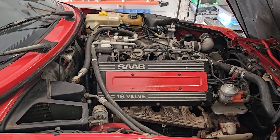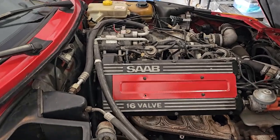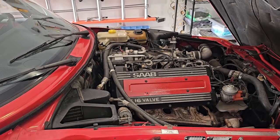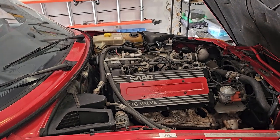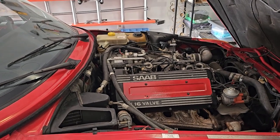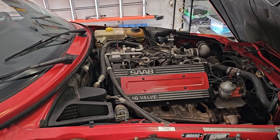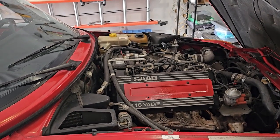did about 700 miles on it, fixed lots of sensors and bits and pieces. Runs very, very nicely, feels strong, all that sort of stuff. But yesterday there was some white smoke, what looked like white smoke, and then I half remembered there was a day I started up and I thought I saw water going through it. I had done a compression test on this thing and it was all 165 pretty much across all four cylinders, close enough, 162, 165.